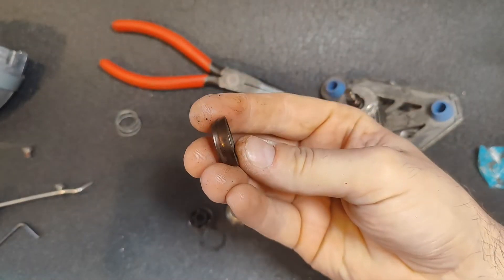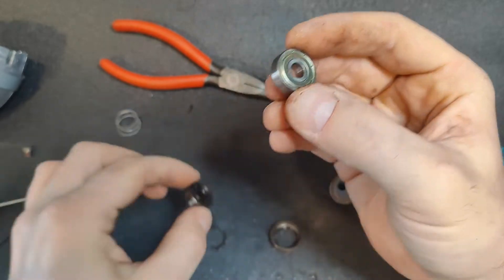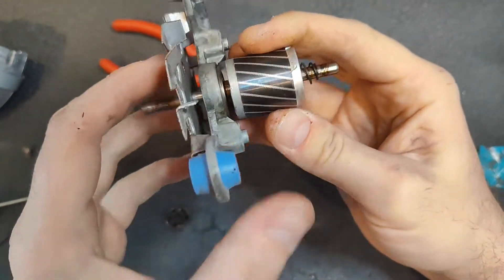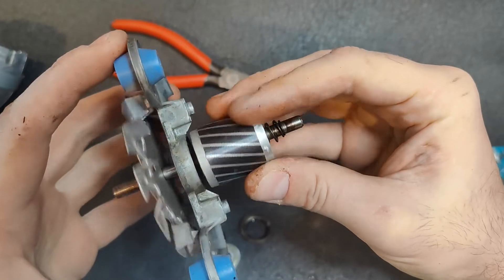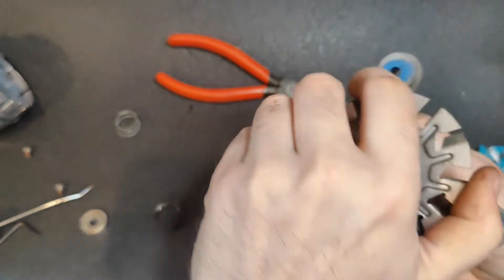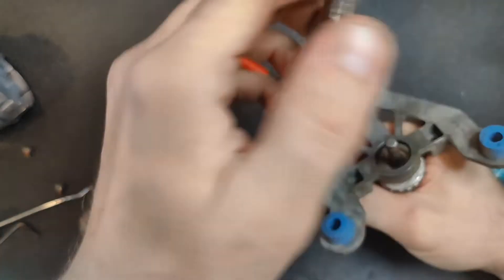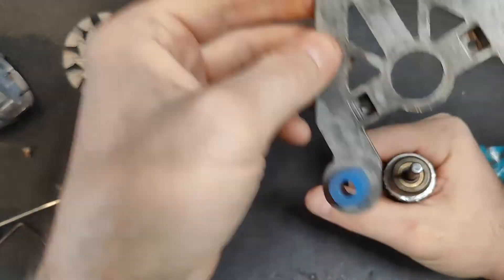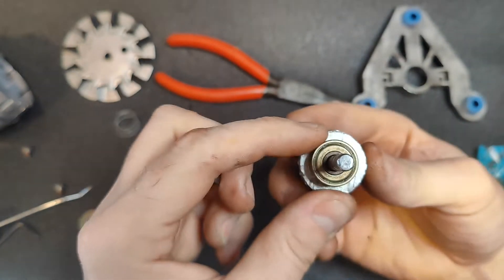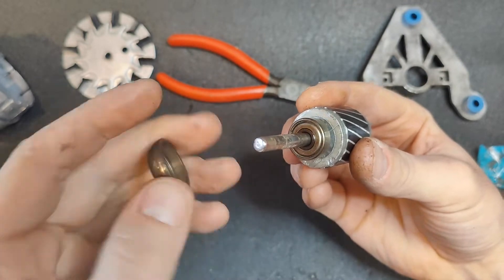I just knocked off the little sleeve that was on the bearing, and now you can see the two of them side by side. This new bearing will go in that sleeve and then we'll just do the opposite. We also have one more bearing just in there — I think that one's quite healthy, but we'll change it while we can anyway. I'll spin off this fan blade here — it feels a little bit wonky so I might have to hammer it straight. That's that out of the way. This one is a lot healthier — that bearing feels quite good and the race came off easily.